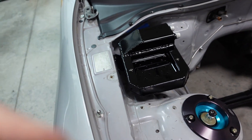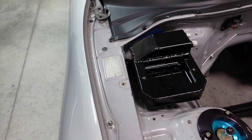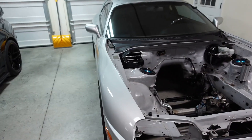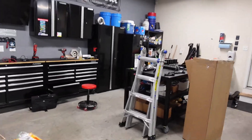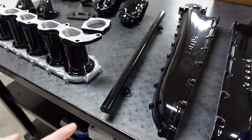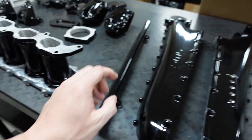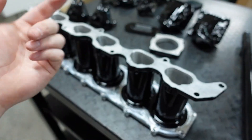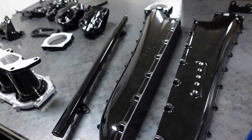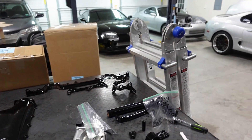They didn't have to powder down here because honestly it doesn't matter — I'm going to put a filter over it anyway, and it breathes out externally so it doesn't really matter. I cleaned all this stuff out, soaked these parts down. For the fuel rail, I soaked it with LA's Awesome then took a brush down the center and cleaned out each one of the little openings. This stuff was easy — I could literally just get a rag in it, hit it with brake cleaner, ran it through, and same with the inside. Everything cleaned up and ready to go, now starting reassembly.